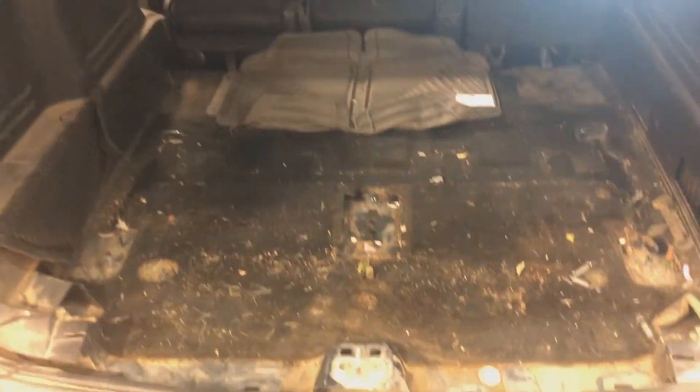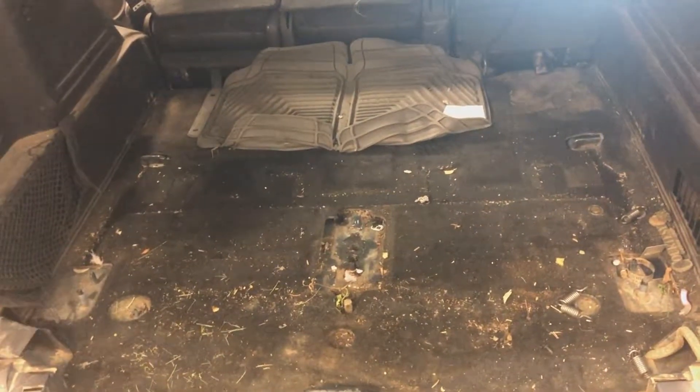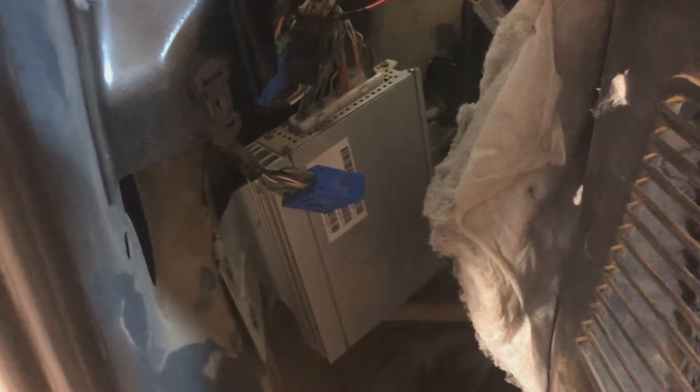After a little bit of convincing we actually had to take the back seat out — this is actually the third row of seating. There are four 18mm bolts, and then the third row seating just pulls right out, super easy. That then gives us the ability to move this panel out of the way, which exposes the culprit right there. That is the factory amp. I've already taken the three 10mm bolts out that hold it in place, and I'm going to disconnect it and make our harness a little bit more accessible.